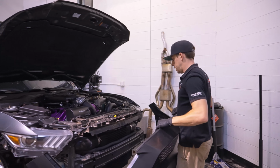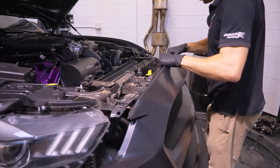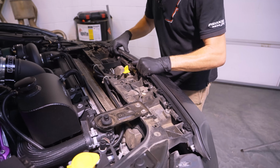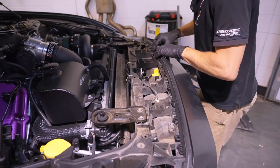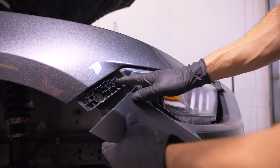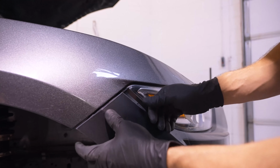We've got our clips changed. We got everything prepped and ready to go. You'll start by aligning these pins on the top. These are the most critical thing to start with. Once those are on, we can go to our side here. On these guys, now you'll really be able to see this portion right here needs this recessed part. So that's why these clips must be changed. It also helps if your original clips are damaged.